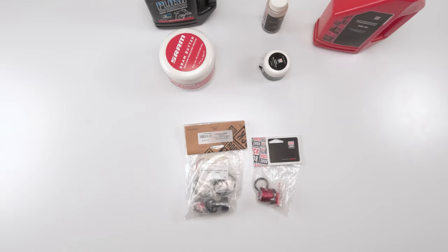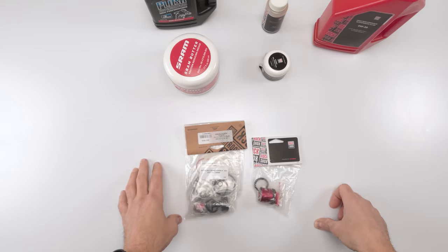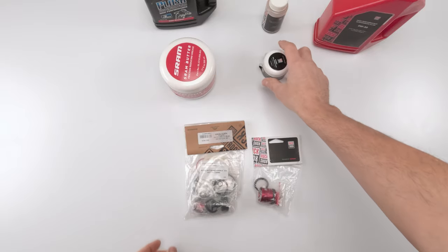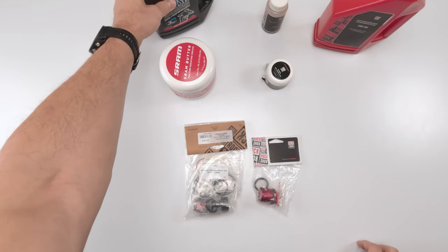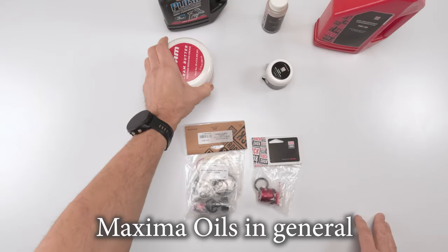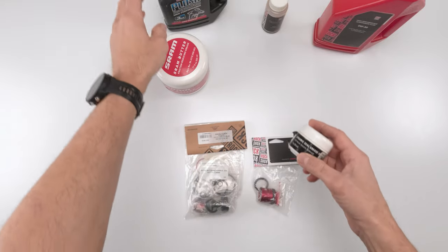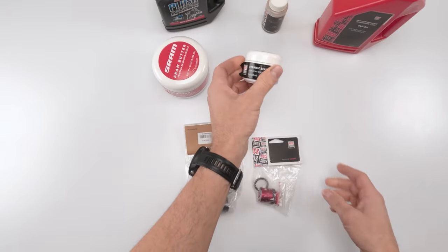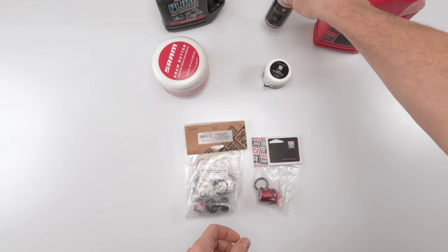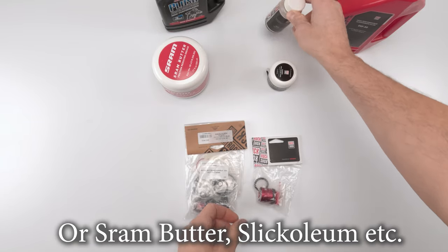So I had learned through a YouTube subscriber, Bob, this one goes out to you, that depending on which oil you use will be dependent on what grease you will use in the fork, okay? So Rockshox is made to move to Maxima Plush. And my understanding is that if you use Maxima Plush oil, you need to use Slick Honey. Can't use Dynamic Grease. Apparently, Dynamic Grease and the Maxima Plush oil don't mix all that well, okay? If you are using Rockshox oils, the old Rockshox oils, then you could use the Dynamic Grease inside the fork, all right?